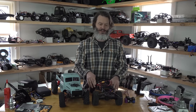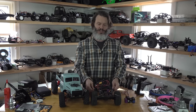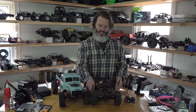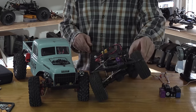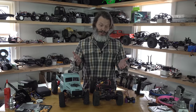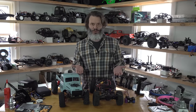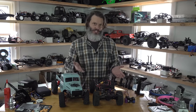The downside of the chassis mounted servo is that when your suspension cycles, you can have what's called bump steer. The Element has such great suspension geometry that it's got practically no bump steer at all. On a bad rig, when you articulate one of the axles, the tires would actually turn with it — and that's called bump steer.